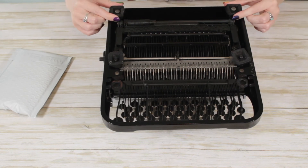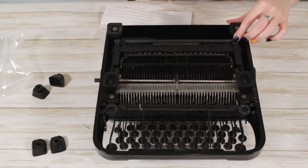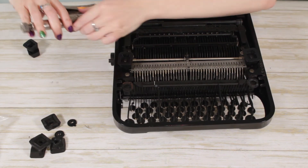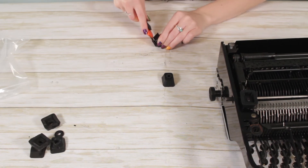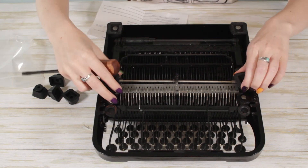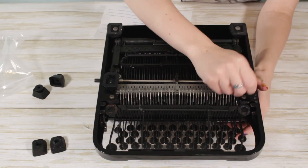Not only were those feet $20 cheaper, they were actually more accurate to what I needed. I purchased them and they showed up relatively quickly. Now I had some trouble replacing the feet - usually it's a pretty easy process if you can get the screws out, but in my case the screws had a really thin slot that none of my screwdrivers fit. I had to experiment with a butter knife and some clampy things to get them loose. Once loosened, I removed the old feet and put in the new ones. The listing noted that all four feet included are set up for the front slot, and if you want to put them on the back positions you have to cut off the rubber gasket on the front. I just took an exacto knife and cut off the little rubber ring at the top of each back foot. Then for the front feet positions, there were no screws - just little rods sticking out - so I jammed them on and set the typewriter back up.